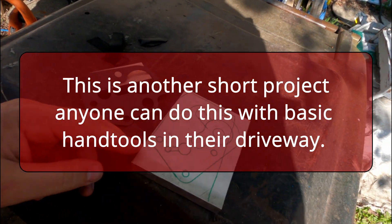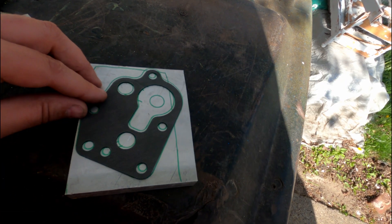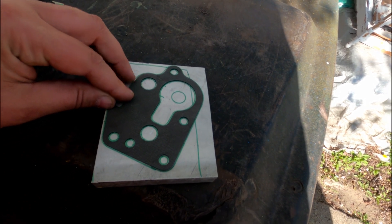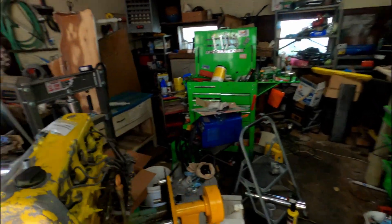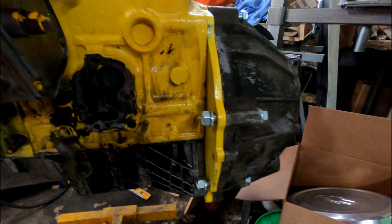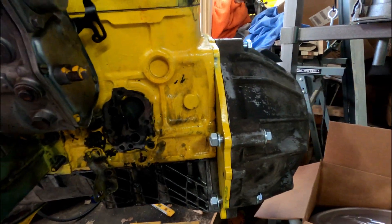I'm back — the Driveway Engineer. If you follow me on social media you'll have seen this picture already. I cut this out of a chunk of scrap from the scrap bin; it's for the oil cooler on my OM617. Everything on my OM617's oiling system is external, so from the factory there's a plate and a big housing that sits in this area, and then there's a thermostat.